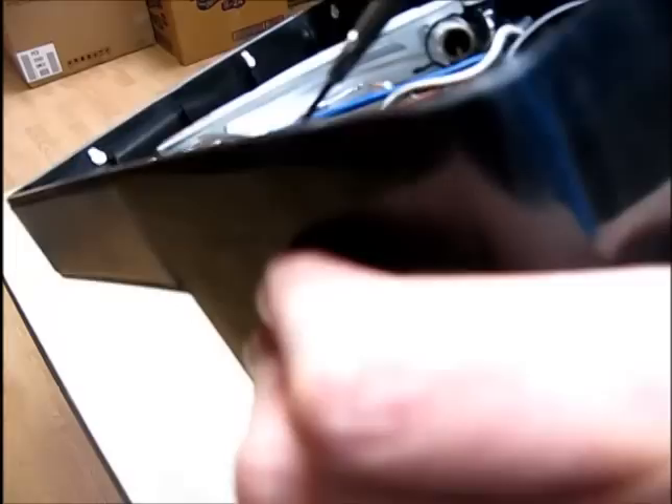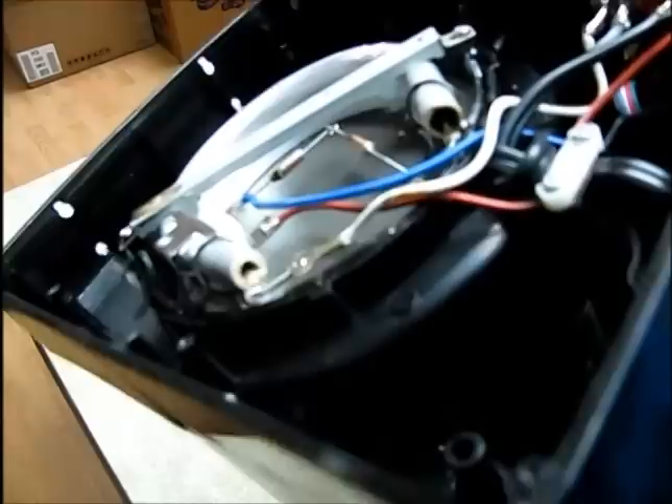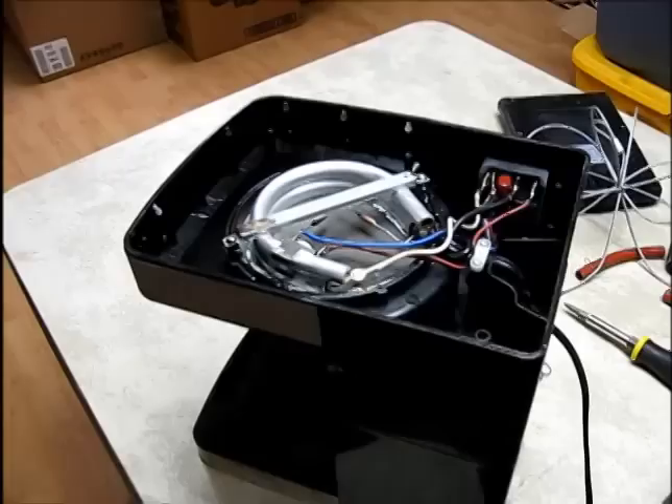The cold end, if you can see it, looks very clean. Coming out the hot end, we've got buildup. What I'm going to try to do is run something through there and see if we can clean that out, because the cleaning cycle didn't do the job — so maybe a manual cleaning will get this thing working right again.